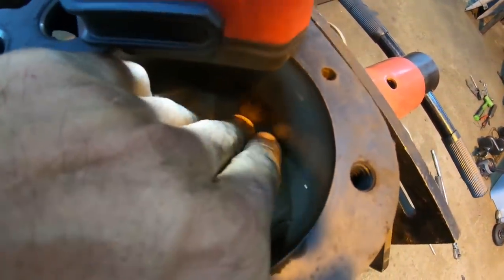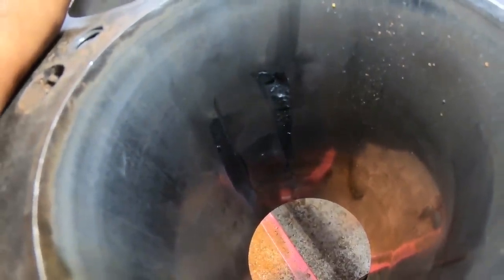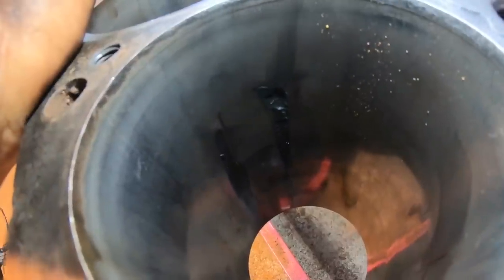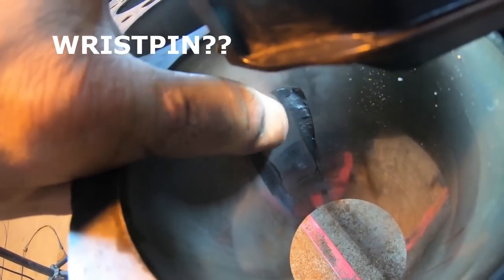On the other side over here, you can see there are some pretty good lines gouged on this side as well, going vertical in there. Now, these center ones here are pretty big scratches. Those would bore out for sure at 125 over. This one over here might be the deal breaker on this engine for me. I'm not sure. I'd hate to sleeve it or deal with anything like that. It'd be nice if it would just clean up, but that top part right here is really gouged in there, almost as if something broke at one point in time and the rod came up or the piston turned and did that, which very well could be the case.